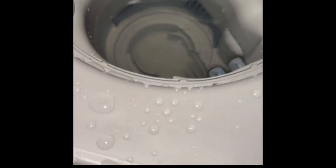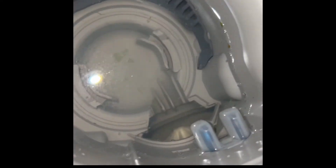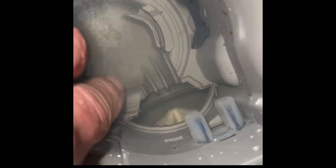Let's see if we can get this back in. If you look in there — there's some water in there so it's a little hard to see — but down here there's a little round thing at the bottom, that's the impeller. That thing has got to be able to turn really easily. Sometimes a little piece of broken glass or chipped porcelain can get caught in there, and if it can't turn, that's a problem. You should be able to reach in and spin it really easily. Be careful though — if there's broken glass, you don't want to cut your finger. This one spins really well. If it doesn't spin well, you can reach in with tweezers or needle-nose pliers to pull out whatever might be caught.